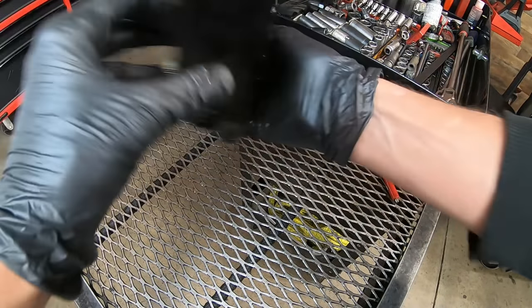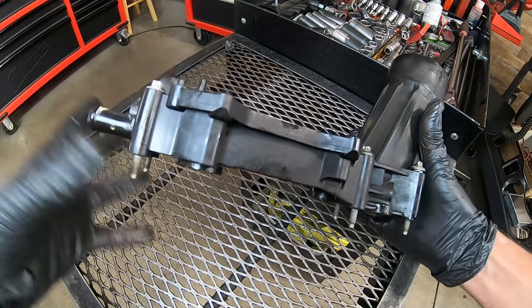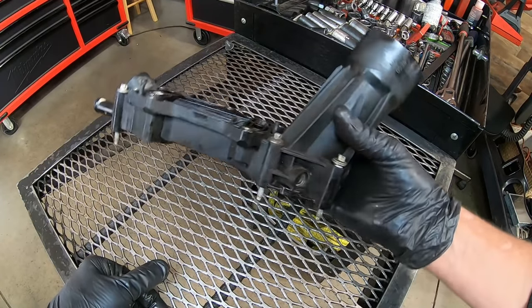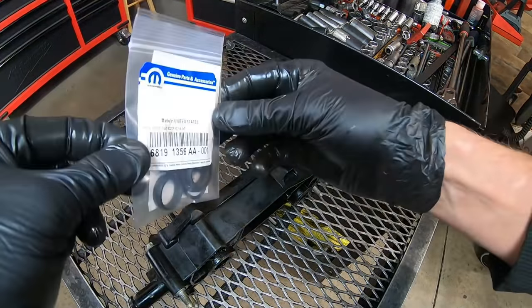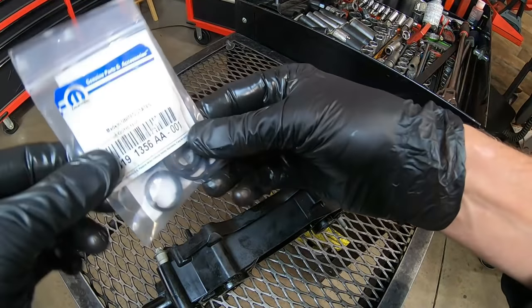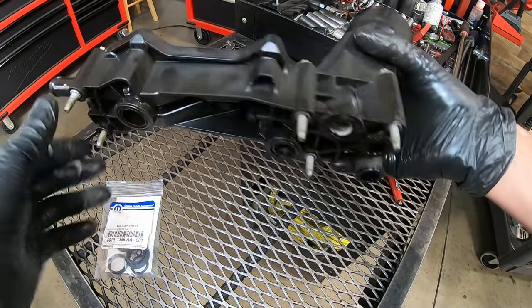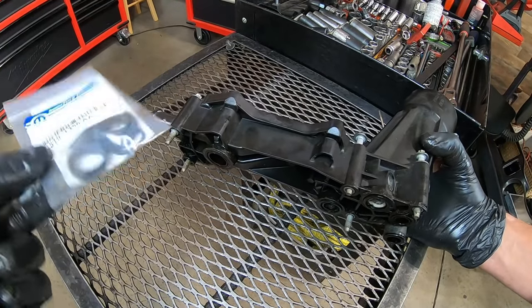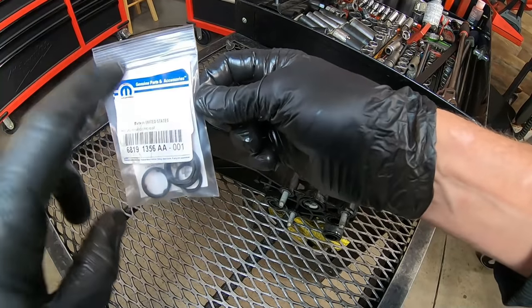When it comes to oil leaks, it's kind of hard to say because this is under the upper and lower intake — it's submerged in oil at that point. We don't know where the oil leak's coming from. We can't clean it off and run it because it's hidden out of sight. We just assume somewhere in this plastic assembly, because that's the only thing that's got oil going through it. In 2014, Chrysler said if you had a problem with that model, replace the assembly. From then on afterwards, they wanted you to replace the O-rings. The O-rings aren't expensive — you can get a complete set that seals off all the ports for oil and coolant, typically around $15 to $20. But are we sure where the oil's coming from? We don't know if there's a crack somewhere. That's the problem — do we go through the same process of replacing the O-rings, and if it doesn't fix it, replace the assembly? Or do both at the same time? At the dealership we had to struggle with that because in order to get paid for warranty, Chrysler said we had to do the O-rings first.